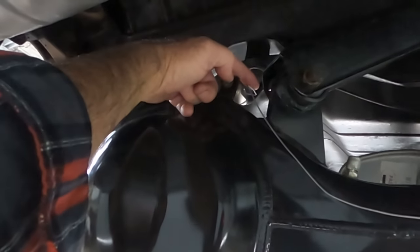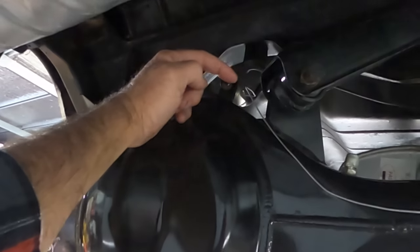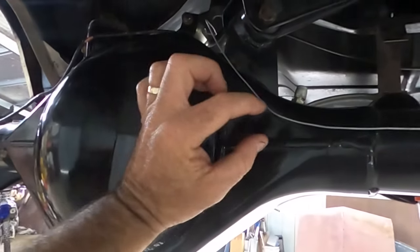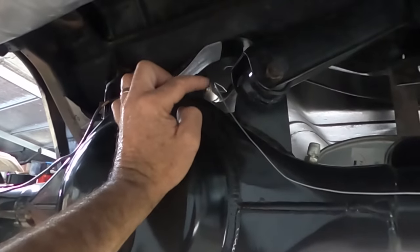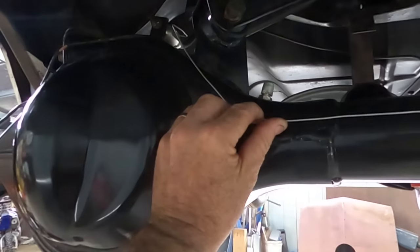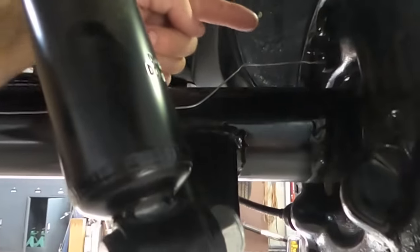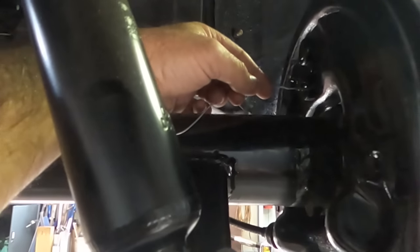So we've got a fairly sharp bend coming out of that block there, like a 75 degree bend, same again here. And I'm trying to stay away from 90s just to make it easy for myself. And I'll sharpen that one up a little through the little keeper there, and then say a 45 and a 45 and into the wheel cylinder there. So we'll take that out.